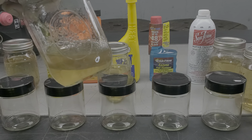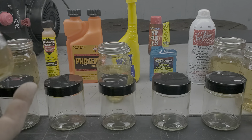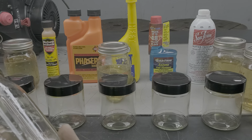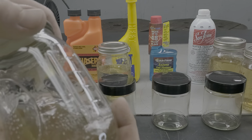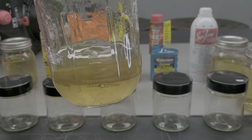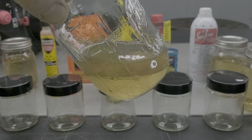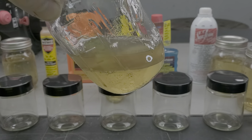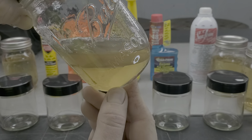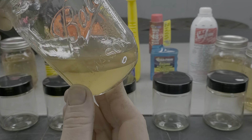The fuel is — I'd say — a hygroscopic solution. What that means is that it's going to gather water from anything near it. It's thirsty for water, even if it can't hold the water, it still will draw more. It's normally from the temperature difference of the air from the inside to the outside of the tank that will draw more moisture. And then as soon as that fuel reaches over-saturation, the water will separate all the way out — to the bottom with the alcohol — and take some of the octane from the fuel at the top along with it.